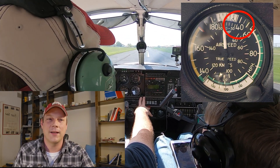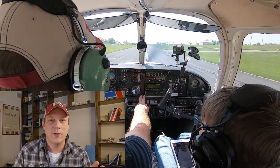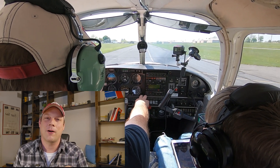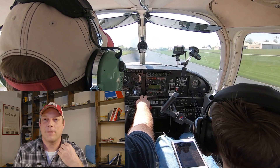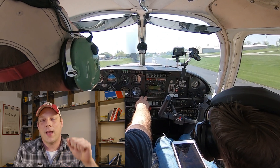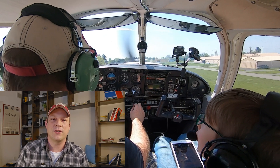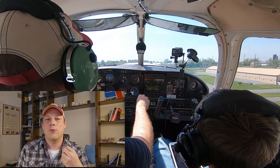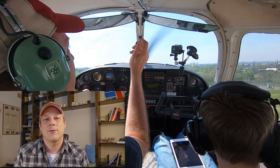So is there any significance to this section? Yes, this part is very important and could save your life. This part, used before becoming airborne, is used to measure acceleration on your takeoff roll. As you push the throttles forward, you don't want to just assume the engine is going to make appropriate power — you want to know that it is and that your acceleration is what you would expect.